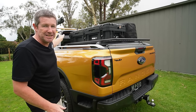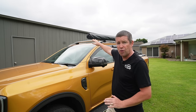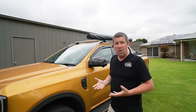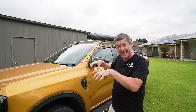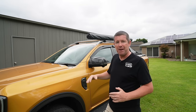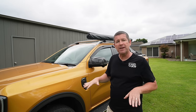Before going through storage options, I'll quickly touch on roof racks and the awning. If you're going to use the roof a lot for boards, timber, or other bits, you might want a platform. Platforms get quite expensive — you're looking at $1,000+ for a full Pioneer aluminium platform with a backbone. Since we've got the factory rails, we could get clamps for those rails, and the backbone will provide better load capacity than simply clamping onto the factory-fitted rails.